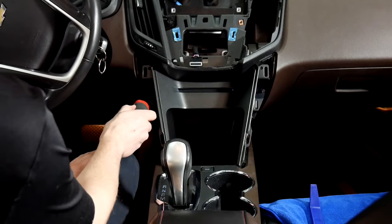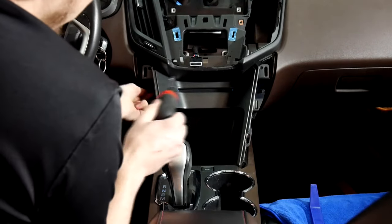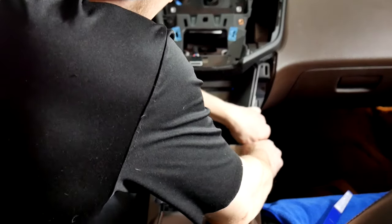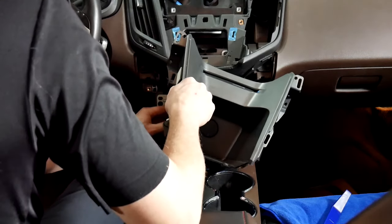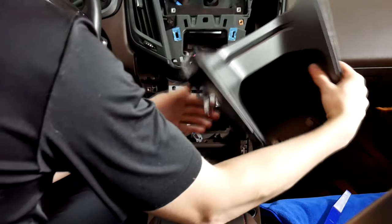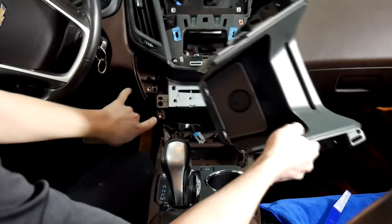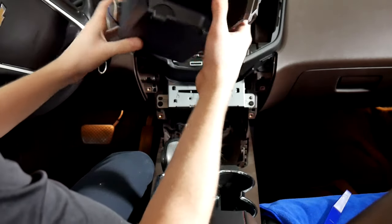Take a 7 millimeter — there's one screw here, one over here, and another one about middle level here. Once we have those out, lift up on the bottom. There are two little inserts on either side, so you want to kind of pull out. There are two plugs on the back. You'll see we've got the cigarette lighter — that's one of the plugs — and this one's for the ambient lighting for the CD port. On the sides you've got bolt holes here and here, as well as over here. This is where that little tab sits, so just pull out a little bit as you pull on it, same thing on this side.